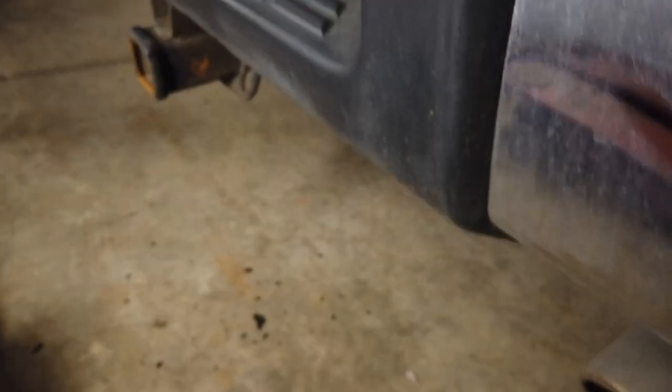I'm hoping that bolts aren't going to break off in the frame rail on me. It looks like a very simple install — I have all new hardware to put in and everything. This hitch is a little bit heavier duty than the one that's on the truck now. This is a factory hitch and I don't think it's rated near as high as this one. I think this truck has a class three on it — I got a class four hitch, good up to 12,000 pounds. We'll be throwing that on as well.